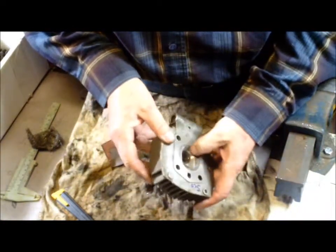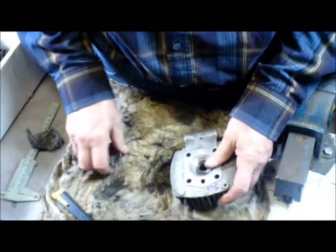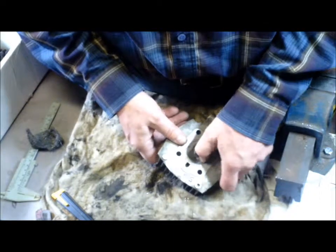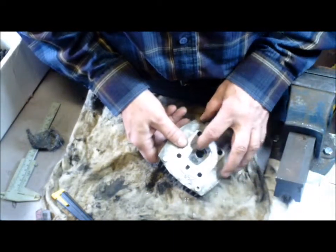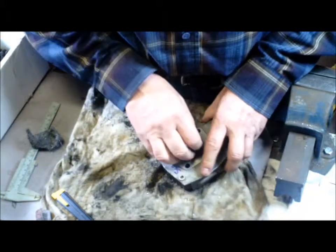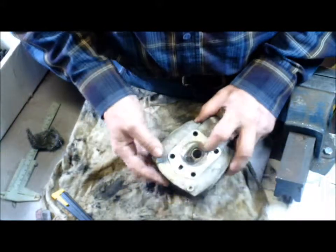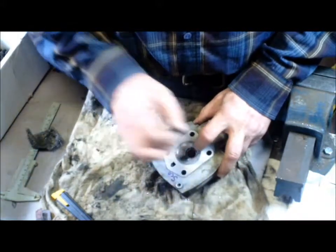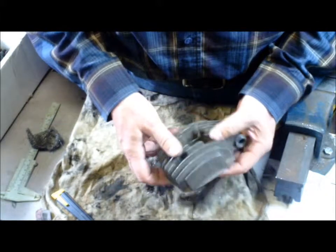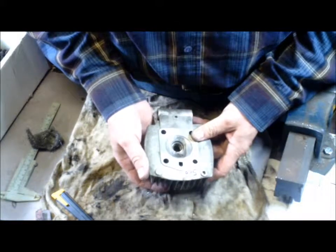That's basically it. The rest of that will come off. Let me get in there and polish it up. I like to polish it up really nice and bright so it's almost a mirror finish. The reason why you'd want to do that is because the smoother it is, the less there is for carbon to catch on to, so it won't build up so quick. Also, if it's reflective, it's going to reflect the heat away from the head. You have to do the same onto the crown of the piston. And then once you're reflecting all the heat away from those surfaces, your heat is there to give you some power. The excess heat goes scooting down the exhaust where you want it to go, not heat soaking the engine.